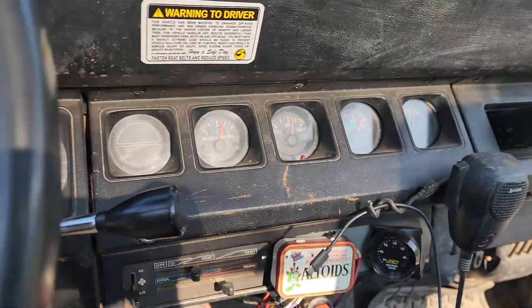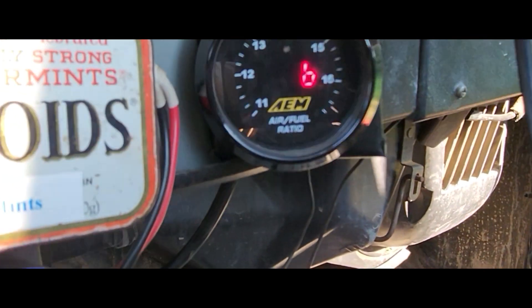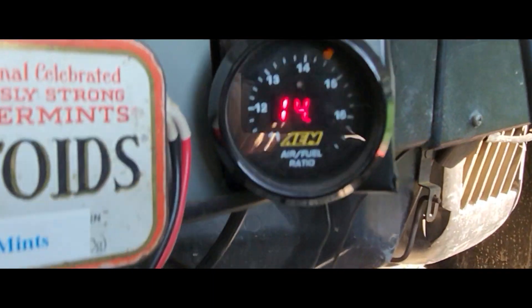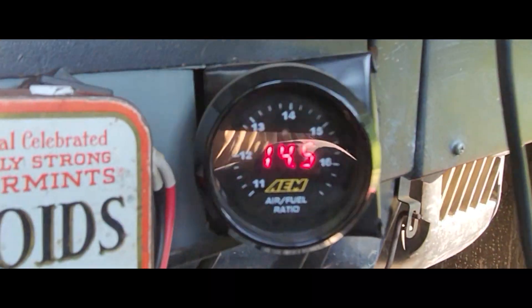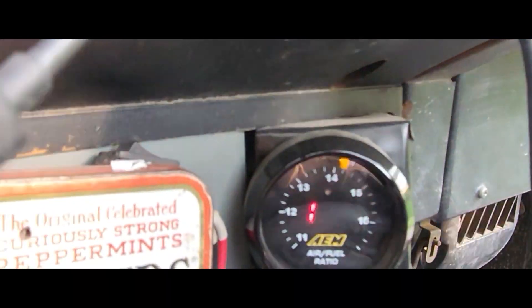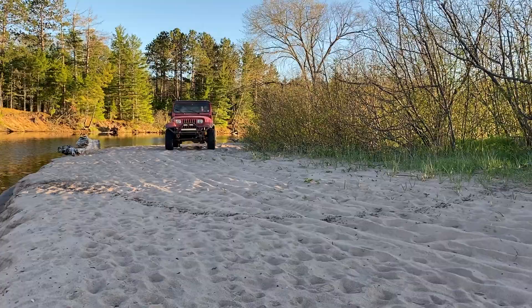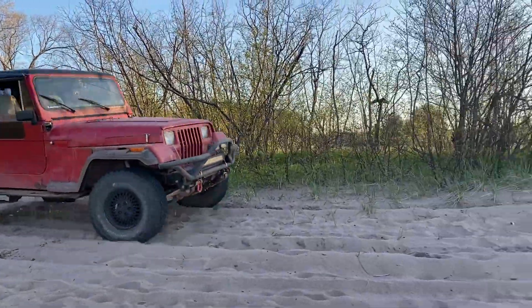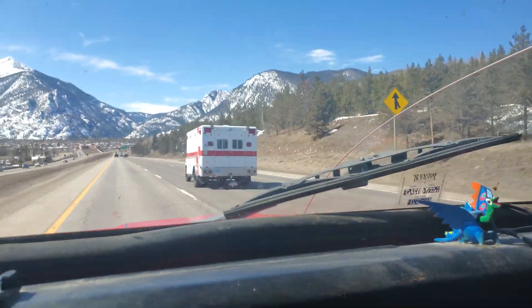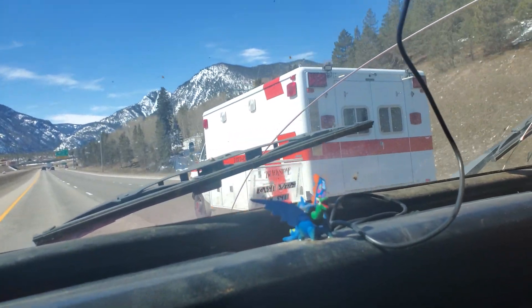Let's talk about operations. The O2 sensor is going to tell you your air-fuel ratio, and stoichiometric is 14.7 to 1. In my Jeep it's really common to have 14.7 or something really close to that, especially at anything under around 40 miles an hour. One of the things I ran into a lot is problems with trusting the readings — if I had my Power Commander tuned to be way too rich, I would actually end up getting a way too lean reading. Some of it could be the piggyback nature of the Power Commander and the ECU over-correcting, but I don't think that's actually accurate because I'd have that happen at 70 miles an hour, and the engine couldn't maintain 70 mph with an air-fuel ratio above 18.